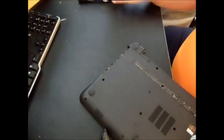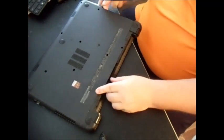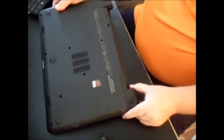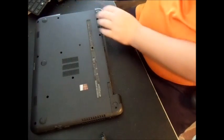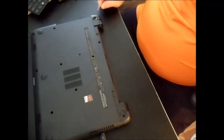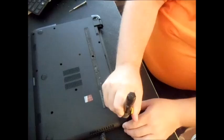Part of the disassembly also involves taking out screws hidden underneath the two rear rubber feet. There are no screws hidden under the front three feet, just the back two. Use a small flathead screwdriver to pry open each foot, remove the screw underneath, and set the feet aside — you'll reapply them when you reassemble. Make sure you take these two screws out, because you'll end up breaking your palm rest if you don't.